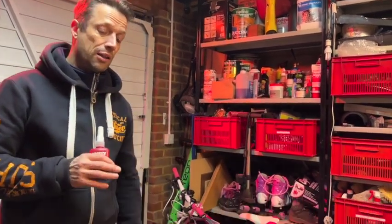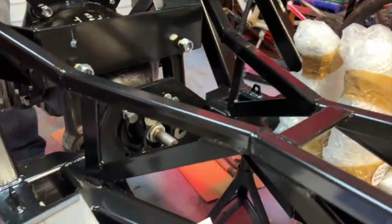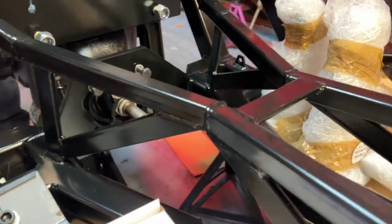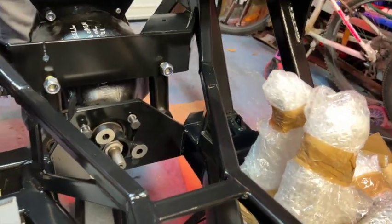So that actually wasn't too difficult. Luckily my garage floor is pretty smooth, and I kept a good centre of balance on my trolley jack. So now I've got a lot of the bolts engaged, so I can drop the trolley jack out of the way and just jimmy the diff into position a little better. I'm going to remember to use thread lock on the nose bolts. Also on the nose bolts, the holes on the chassis might not be quite lined up, so it's a good idea to start attaching the bolts now and do it up, and it'll draw it all in and flush together. Or alternatively, just open up the bolt holes slightly.